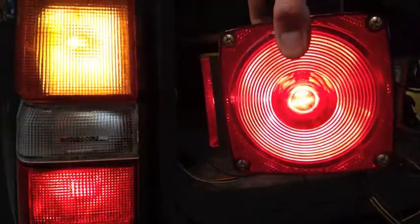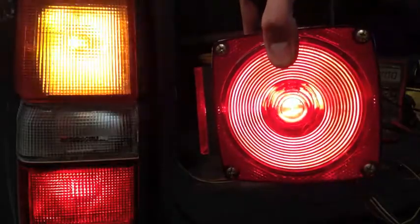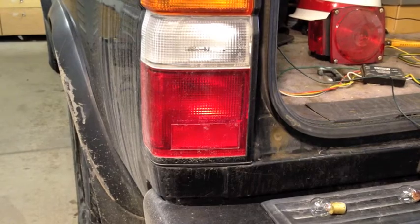About a year and a half ago, I wired up some lights on a trailer, and everything went well until I plugged them into the truck and I realized that they were really kind of dim. And I thought, maybe I got crappy trailer lights, and I tried a bunch of stuff, and I checked a bunch of grounds, because, of course, as soon as anything goes wrong in a trailer, somebody tells you, dude, it's probably the ground, and it wasn't the ground.